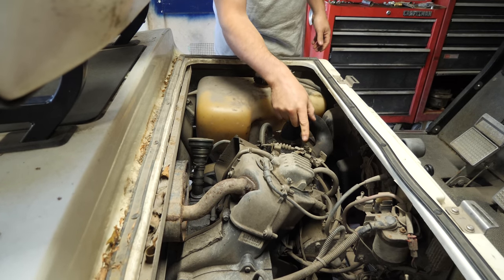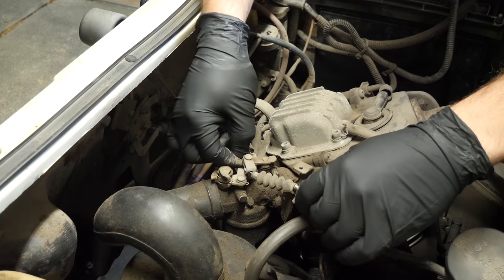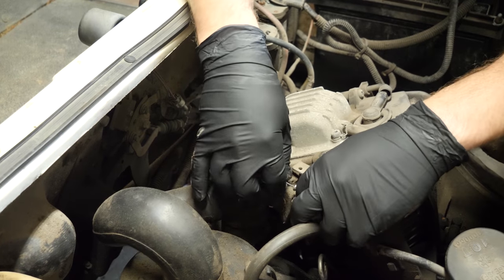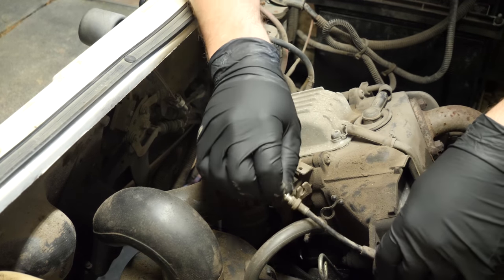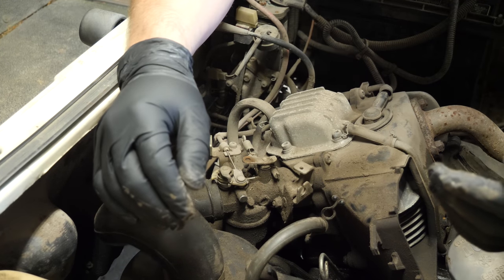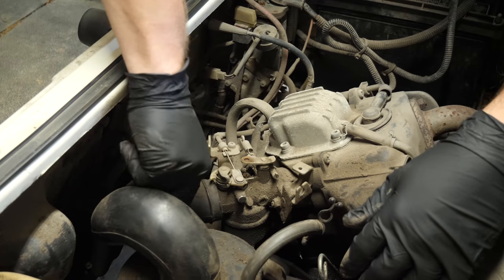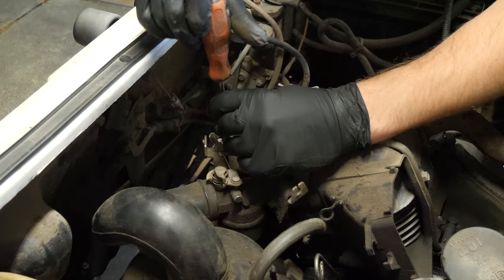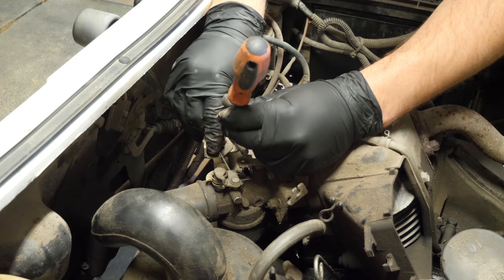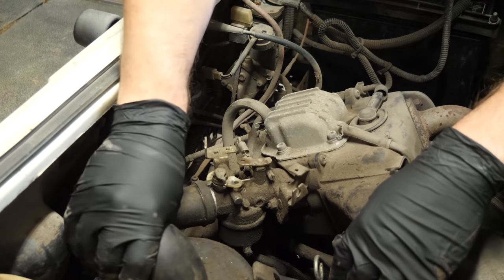So on this one the carburetor is on this side. This one's missing the e-clip holding the throttle cable on. That'll make for easy removal of our throttle cable that's been zip tied to the oil fill tube. We're going to completely remove the air box on this one as well to get it out of our way so we have better access to all this stuff. This is our choke retention clip. There's our PCV hose. Now I can take this off.